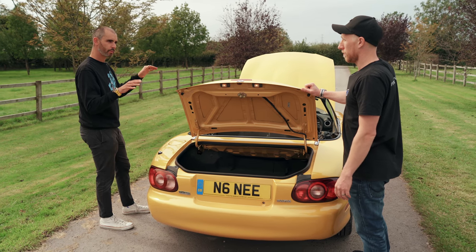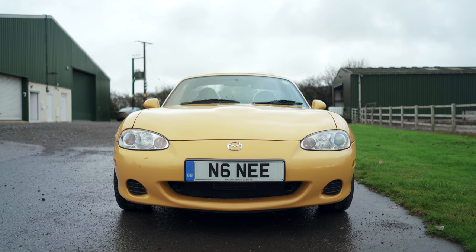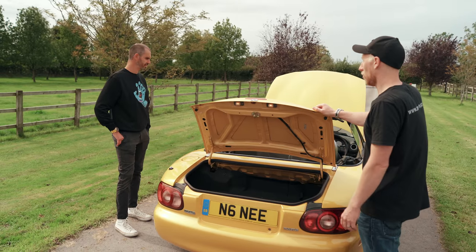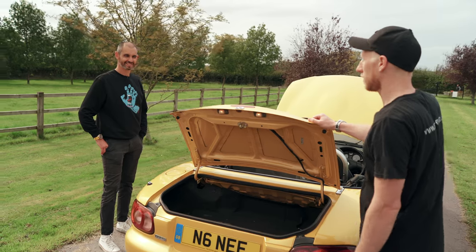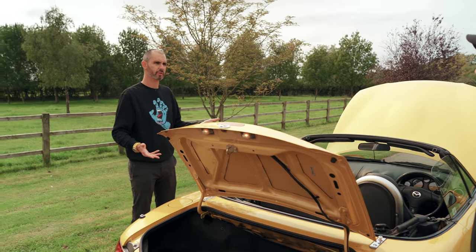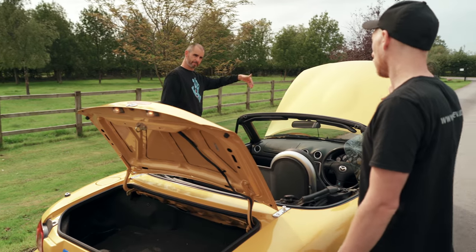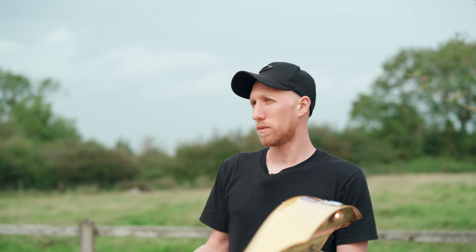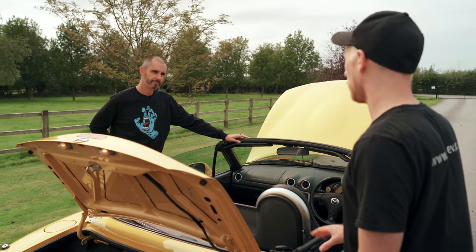The weight distribution is almost the same. What about the weight? 1,070 kilograms. The original was about 980 — so 90 kilos in it. That's basically one person sat in the seat. That's really good. It's mainly down to the range though — if we went for more range, obviously you're going to be over on your weight. So if someone's watching this who has an MX-5 and wants more range, you could put more batteries in there, but you'd be adding maybe 150 kilos. We've got regenerative braking as well, but we've got to be careful how much we do because it's only on the rear — you don't want to lock the back up.